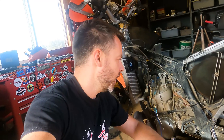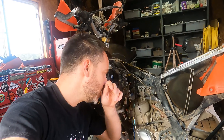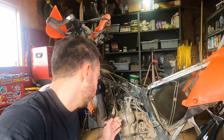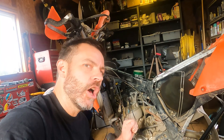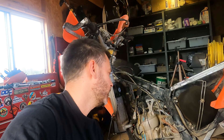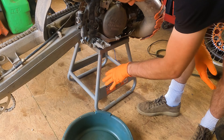Back in the shop, it's a new day. I'm a little frustrated with this project — it didn't work. The stator actually grounds to the frame, and that's not really how you want to do it when you have a DC side system. It's better if the stator doesn't ground to the frame internally and you ground the DC system to the frame instead. But I'm not getting any voltage off this thing. So what I'm going to do now is pull the stator and see if I can undo the internal grounding where it grounds to frame. You can float the ground on the AC side and still have a return path, then ground the DC side to the frame using the new Trailtech stator. But in order to make that work, I've got to pull this. First I need to figure out how to drain the oil without getting it all over everything.